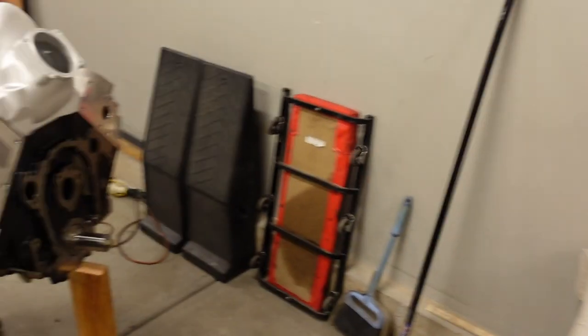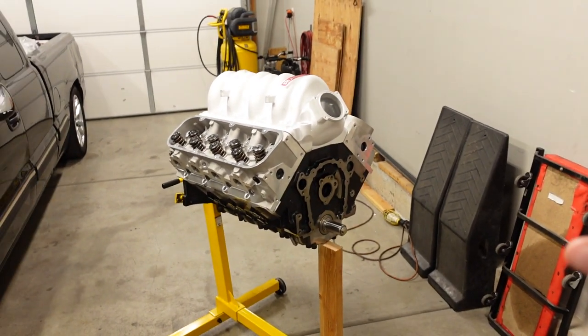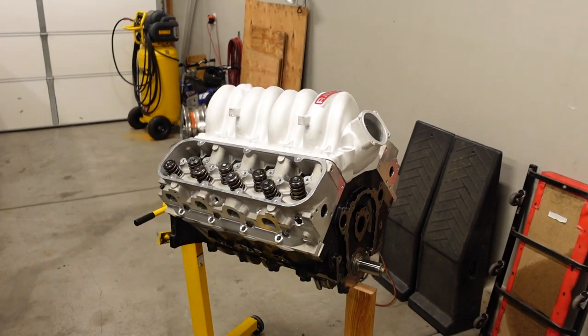Even though the economics of that, if you can buy a 5.3 for say $600 or $800, you could put quite a few of those engines together before you pay for something like this. But anyway, I want something that's relaxed. I estimate this will take only 15, 20 pounds of boost to get to my power number versus, like the cool comparison is between a small 2-liter Honda motor. Those guys can make a legit 1500 horse as well, but they'll need like 80 pounds of boost where we only need like a quarter of that. So that's my thought process behind building this particular platform.